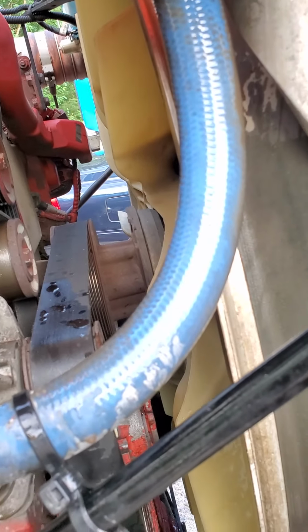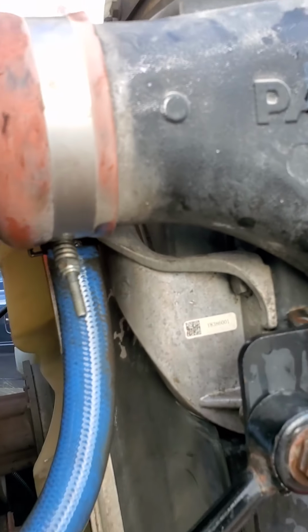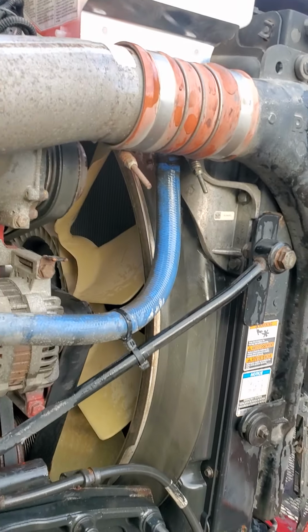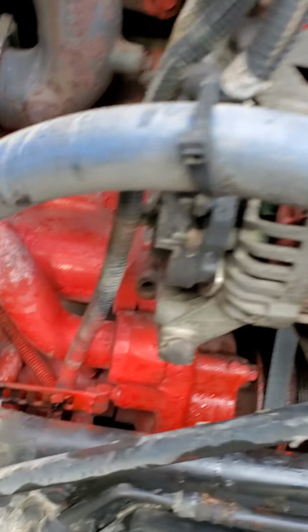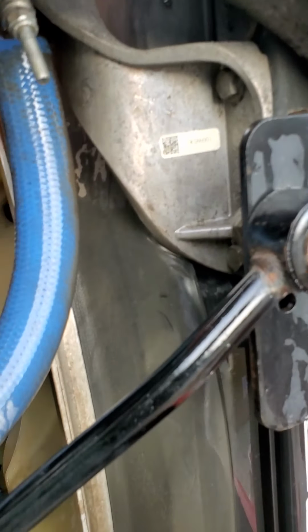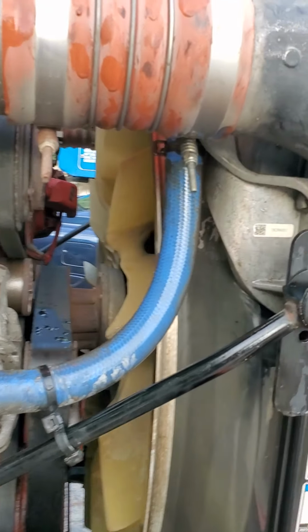So don't just come and think you're gonna catch the coolant coming out of the reservoir, because the compression is gonna push coolant back up out of this also. So bring 2 jugs. Don't make the mistake I made. One for your hose, because coolant is gonna be coming out the block out of this hose, and coolant is gonna be coming down. So bring 2 jugs. What else? So now we got this in.